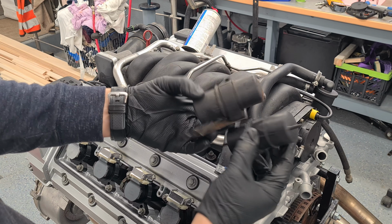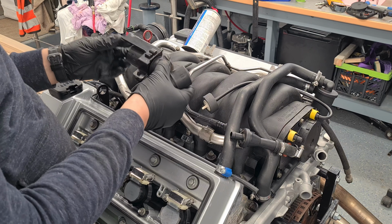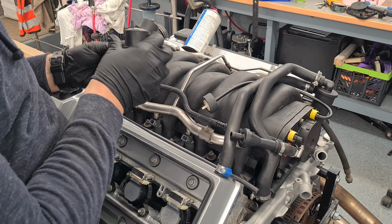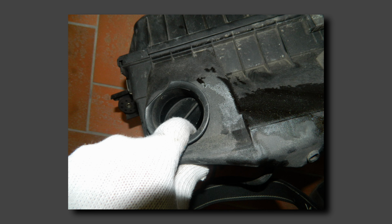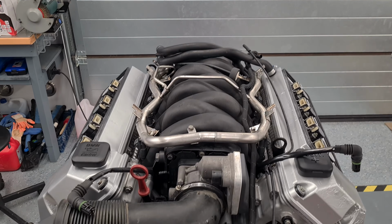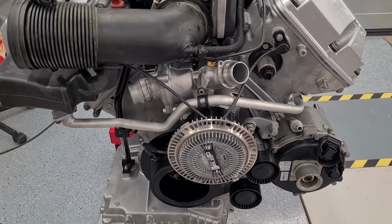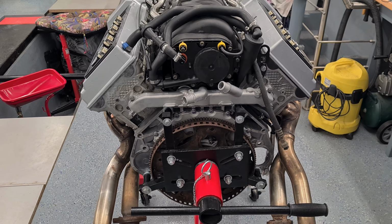Of course yes. Besides the secondary air system vacuum valve, these 4.6-liter engines have an additional vacuum valve, which opens extra air flap in the air filter box, delivering more air and thus more power. You'll see it in the next episode. I left wiring harness for the next time. I need to align some wires and plugs. I'm hoping to first run this thing in the next episode. Thanks for watching.